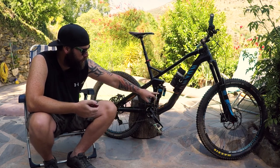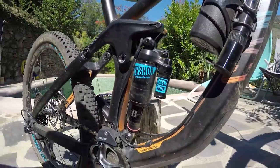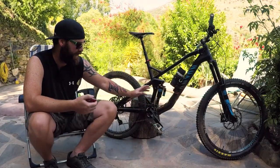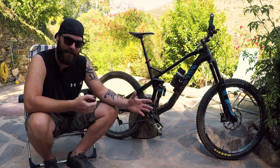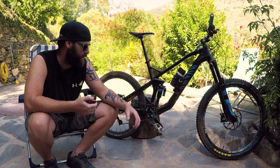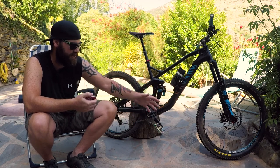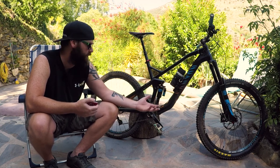In the front triangle here we've got the Rockshox Monarch Plus R rear suspension. I've not done anything major with this, though I know there are adjustments you can make. I've played with the air pressure and the rebound just to make it pop up less, because having it too firm at the back on steep downhill stuff tends to make me feel like I'm going to go over the bars. I run quite high pressures being quite a big lad, and I've not touched the internals — there's a version of volume spacers you can put in the rear shock but I've left that alone.